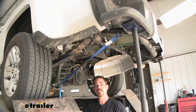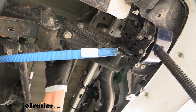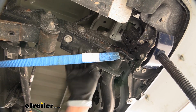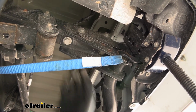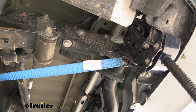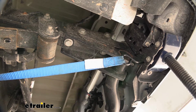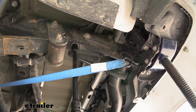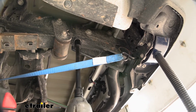and then we can go over the hardware that we need to remove. Now on the bottom of the frame we're going to have 2 bolts. Those are going to be holding in that beam on the bottom. But if we look on the side, we're also going to have 2 more bolts that we're going to have to remove. So for the ones on the bottom, I'm going to take a long extension and a 21mm socket and pull those out.